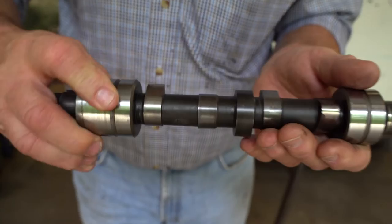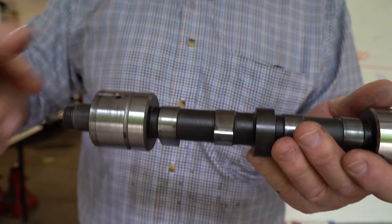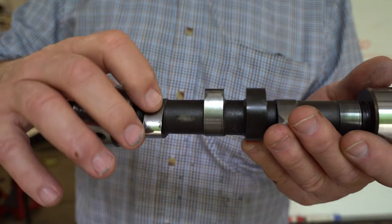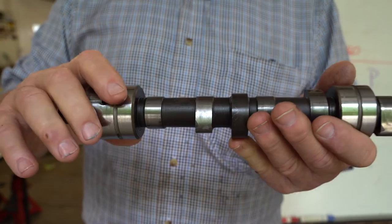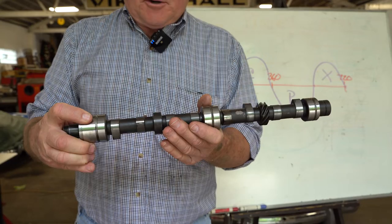Anyway, you can see that on the back side of this lobe, for a full turn of the engine, the cam follower doesn't change position. This is all the flat part of the cam. So number eight doesn't have to be fully open to adjust number one. So it can be here or here or here or wherever, watching that number eight lobe, and you're still okay.